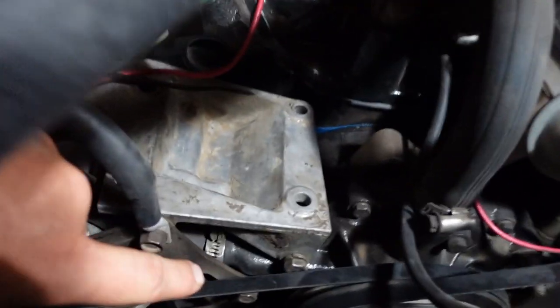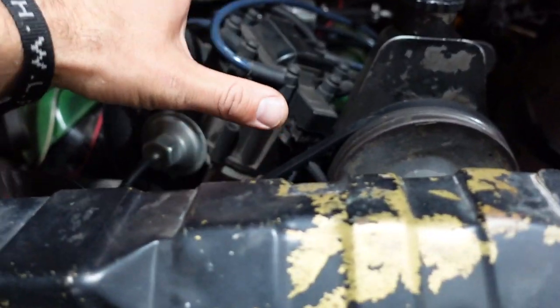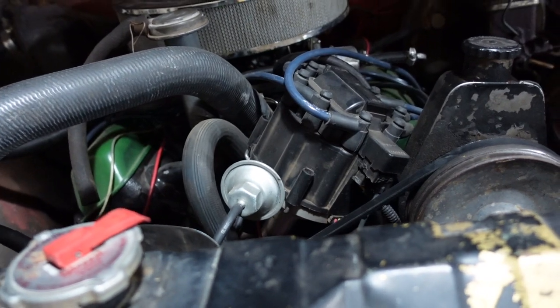One thing I did to make seeing the timing mark a little easier: on the harmonic balancer in that little groove, I used some white paint and painted it white in there, then it shows up really well when you're running the timing light on it. You just look for your timing mark — there should be a timing mark, and I can't really show you because everything's painted black. There's a timing mark on the front cover that lines up with the little timing mark on the harmonic balancer. You just watch when it flashes on the timing mark. It's laid out so this one goes one through ten before top dead center; other ones may have up to 15 or whatever. So you just look at that, find out where your timing's at, and if you have to adjust it, you just turn your distributor one way or the other, whether you need to advance or retard.